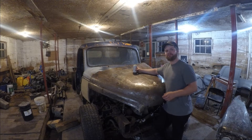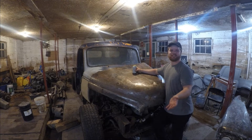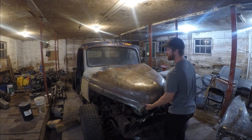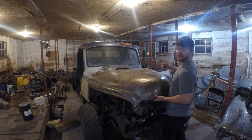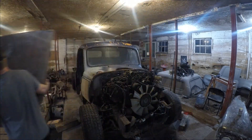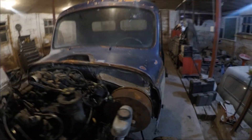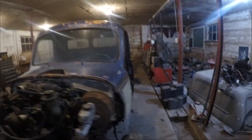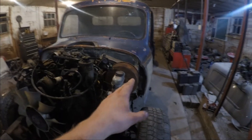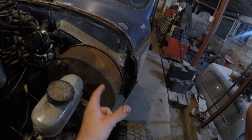A real easy one we're gonna have to do is basically get this hood situated on top of this truck. We lost an episode — I showed you guys a whole bunch of stuff but we'll get into it some other time. This hood fits fine on one side but on the other there's a little guy in the way. I wasn't sure how much of an issue this vacuum booster was going to be — it's a 12-inch vacuum canister, basically subway sandwich long. When we put the hood on, it's hitting right here.